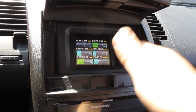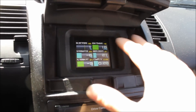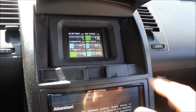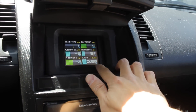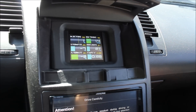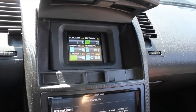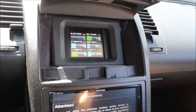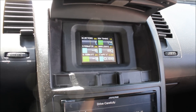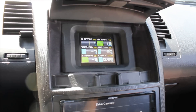I'm hoping some other people can chime in and provide links in the comments to show what these Nissan 350Zs need to see in terms of parameters. That way, when people check this information, if you don't know where your baseline is supposed to be, it's kind of useless. We know we need to be around 14.7 on the air-fuel ratio. Until it warms up, 0.45 is perfect, but these cars can run 0.6 to 0.7 volts — that's actually normal.